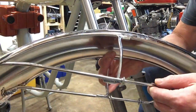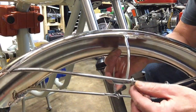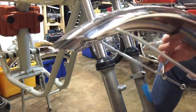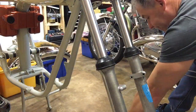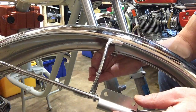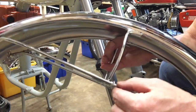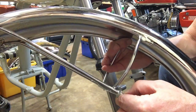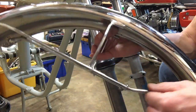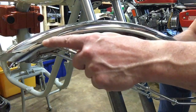On the mudguard itself, on the wire stays on each side, you've got an area that's bounded by two butt flaps and the wraparound bracket. If you like, it clamps from either side against rubbers that you put around the wire stay. Just circular cylindrical rubbers, and obviously you've got to cut one side of those to actually fit them over the wire stay. You'll notice that this mudguard has got three fixing points for the wire stays, one in the middle and one at the other end.